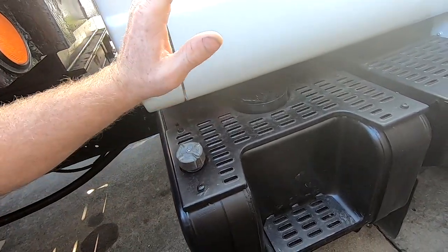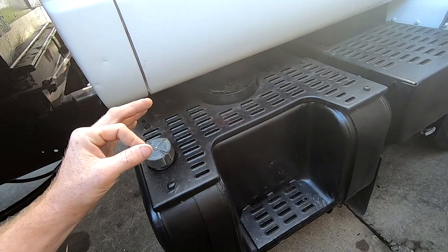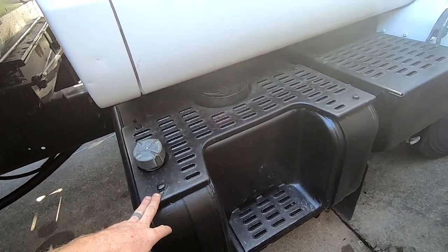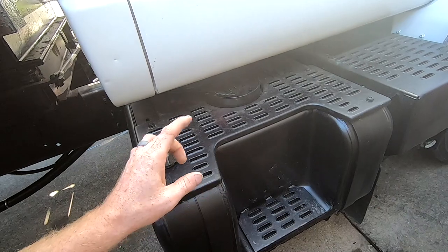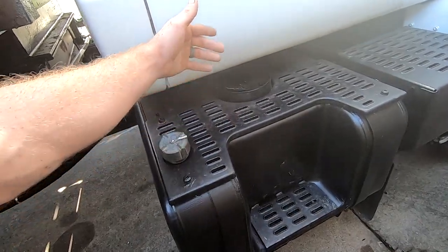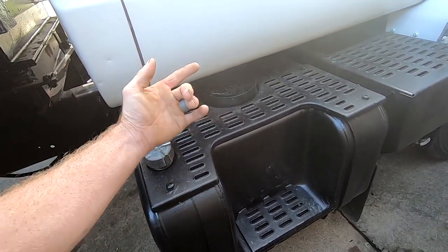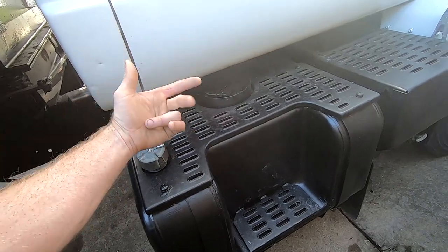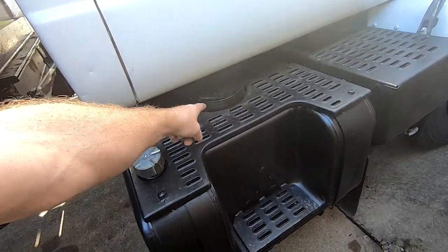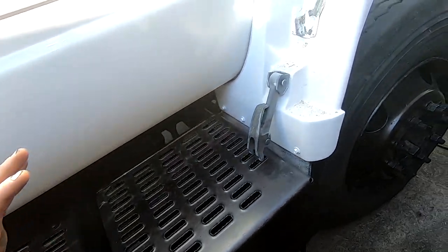But one thing to note when working on machines and buying parts, especially parts made to lower quality overseas, is never expect a brand new part is always going to be good out of the box. There are many times I've bought parts that are bad right out of the box. And if you just assume, oh, that's a good part, no big deal, we just keep troubleshooting, you'll never get past the point at which you had that bad part. I think more likely what happened was the fuel pump was just bad and wasn't sending pressure. So the second I replaced the fuel pump, the thing fired up, just as you saw in the video. So I worked through those issues and got everything working well.